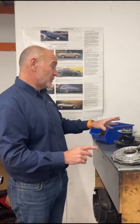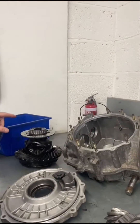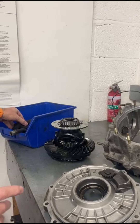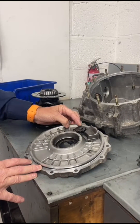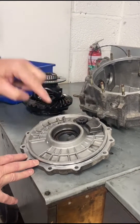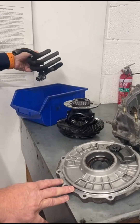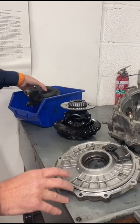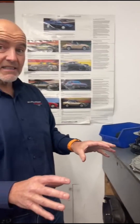The only other thing that's a little unusual is this car has got an upgrade oil cooler from the factory. It runs a little oil pump off the back of the diff — it's not a limited slip diff — but it does run a little oil pump that sends the gear oil out through a little external oil cooler, keeping everything working properly. Parts will be in today, we'll build it and get this back on the road for the weekend. Thanks for watching.